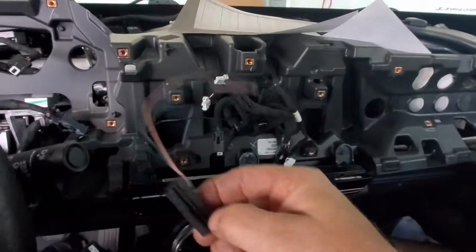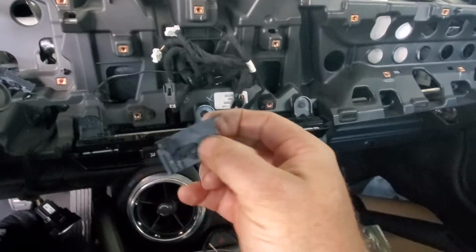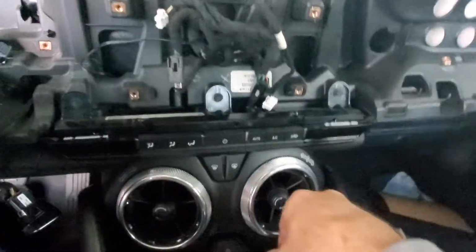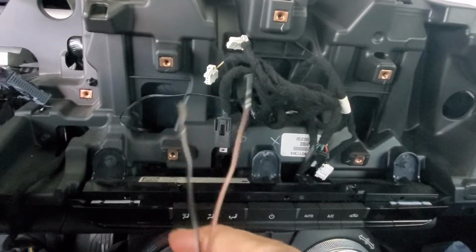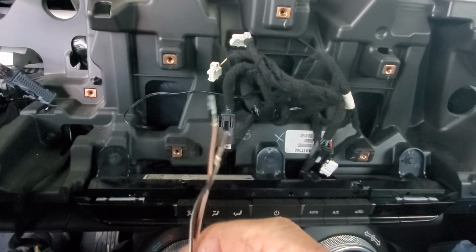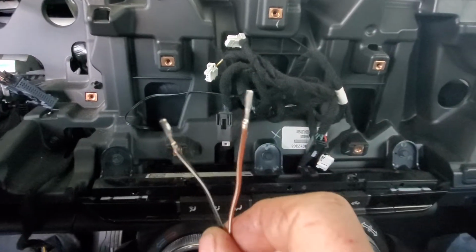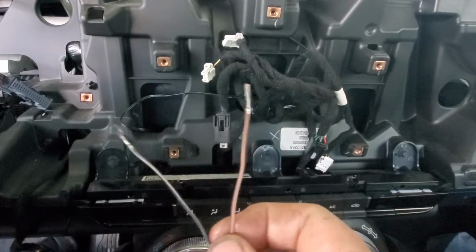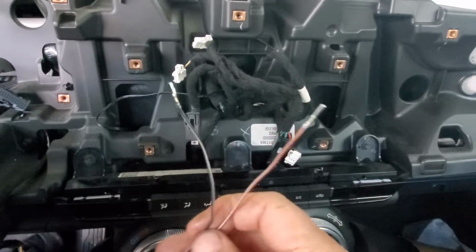But anyway, this is the piece that you see that comes out of here. And you basically just put a screwdriver and it pops right out. What I'm getting at is, these are some of the factory wires right here. And in the write-up on Camaro 6, I love you guys for doing the write-up. It's what gave me the push to say, oh hell, I'm going to do it myself. But you buy the package 100, I'm going to tell you something. I will read schematics and deal with this kind of crap every day. I'm never going to make a connection as good as that automated system does. Just go get you some wires, or go get you some harnesses and just take this. And what I did was I just plugged it into pin 21, and then I wired it to this plug.